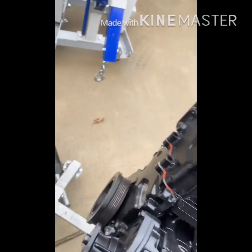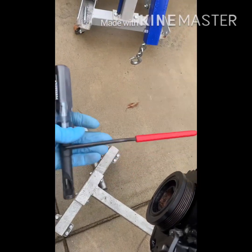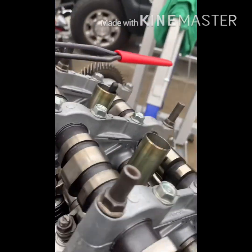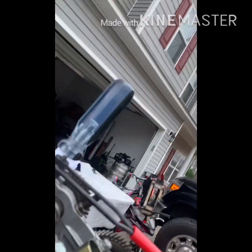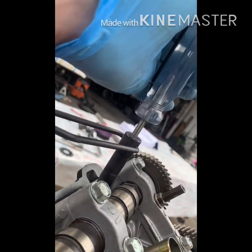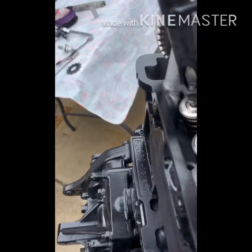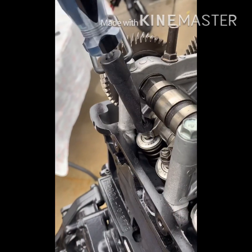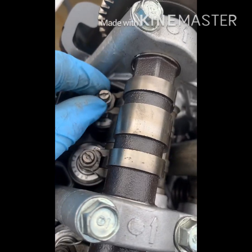Check out this sweet tool — you can get it at AutoZone or O'Reilly's for 10-15 bucks. It shows you where the bolt is and allows you to line the screwdriver up there. So what I want to do is just loosen this bolt. Now that it's loose it doesn't take much force at all — I just loosen up the valve. Now there's no tension on the valve, they can move it up and down. Good to go.